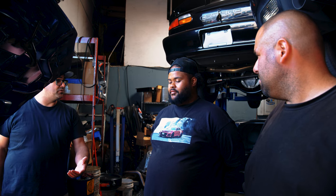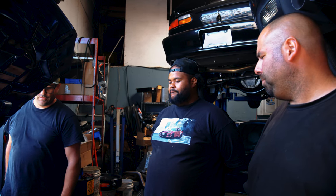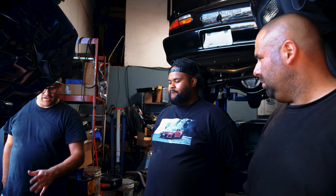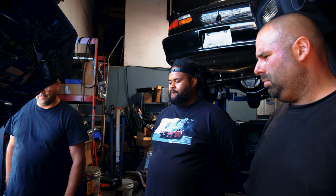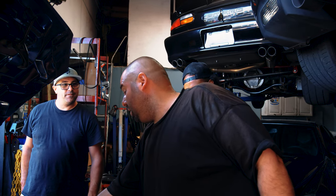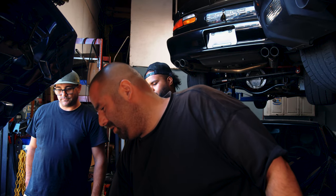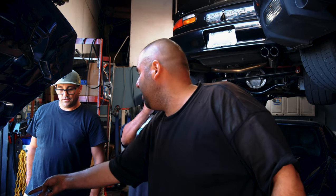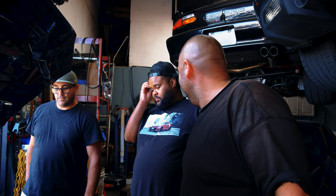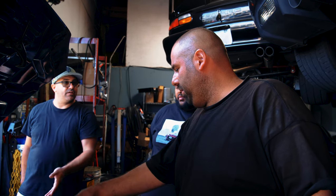Mechanically it has to be regulated because there's no way the factory fuel pump is regulating it down to 45. And typically when you put a big pump like that on a factory system at idle, the pressure is very high because it can't return enough fuel. And I don't know if that Vortec inline is going to be a restriction if the 450 is trying to push through a smaller pump. Nothing we have to fix today — that's not going to impact what I'm doing today. I'll throw the injector data in there. If you have a 450, I would just delete that whole thing, Josh.